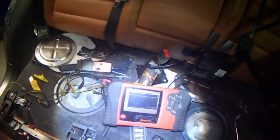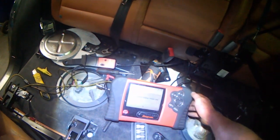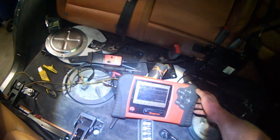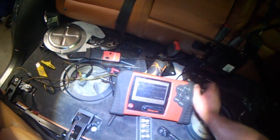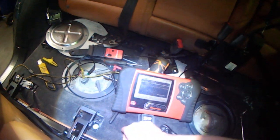One more time and I'll save it for you. Key is off, key is on — 12 volts. Cranking, starting the car — the car is running, 11 volts steady. But it's going to start dying out in a second.